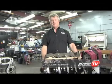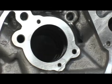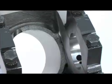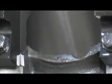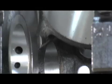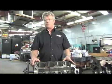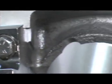Dart is well known among Ford racing enthusiasts for our engine blocks. These were developed in conjunction with Roush Racing. We basically strengthened all of the bulkheads, used a higher grade of iron, and added a lot of features that allow this block to live in a high horsepower application. Now we're introducing a new block for the sportsman racer and street performance enthusiast in our Special High Performance line. This block is far superior to a factory casting for performance use, but does not have all of the features of a race block, which frankly a street performance or entry level racer doesn't need. It does, however, have all of the features you do want for those kinds of applications.